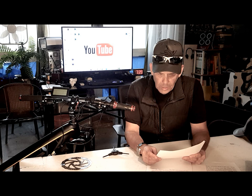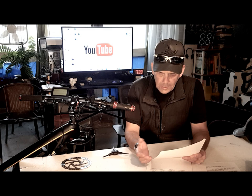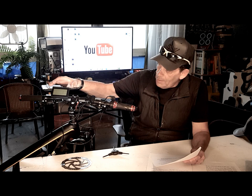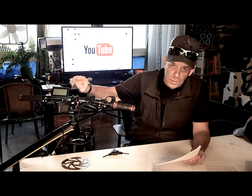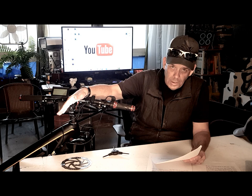Here's one from Florida: my power seems to run out when I reach the end of two bars, even though there's a fourth bar to indicate a low battery. Is this just wear and tear? I'm going to try the P5 real-time setting today. The P5 setting is one of the most important settings. It controls what your voltage is. If it's 24 volt, set it to 11. If it's 36 volt, set it to 15. And for 48 volt, set it to 15 as well. That will give you a real-time display of how much power is left in your battery.